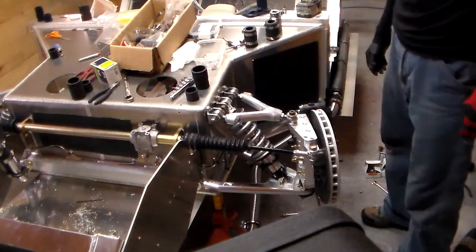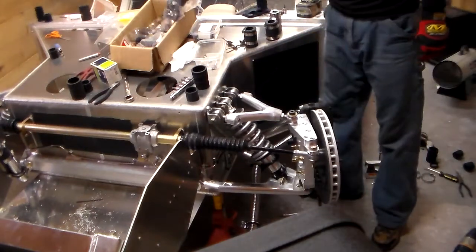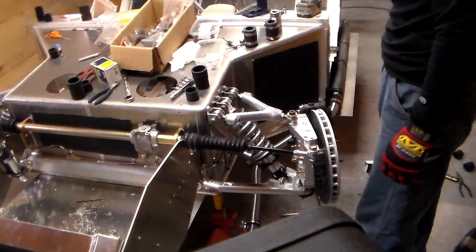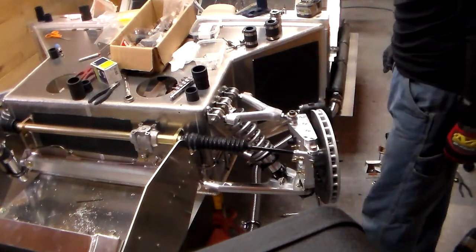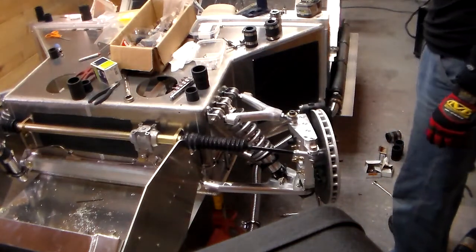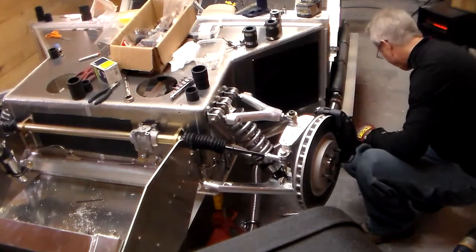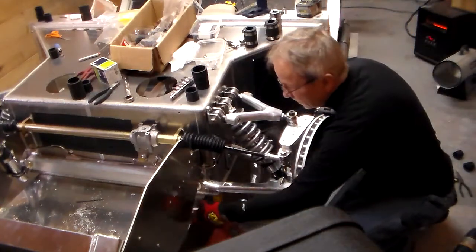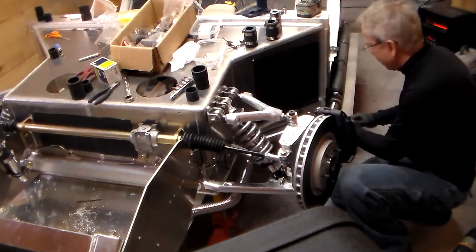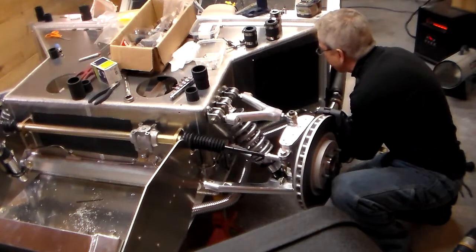I already drilled the holes for the clamps and they're ready to go into the tapped holes. One hole I just used a bolt — I'm going to put a nut on it because of the A-arms; it's too hard to get at to tap. I can just put a nut on the inside way up in the foot box where you won't even see it. I've already inserted the flex line into the main line coupling here, bent it roughly to shape, and now I'm going to tighten the clamps down using socket head bolts so I can apply pressure as I'm tightening them.